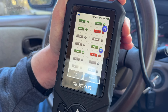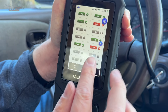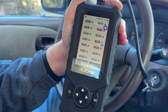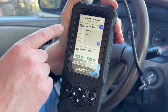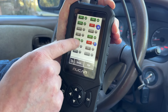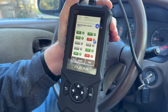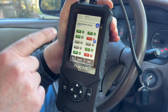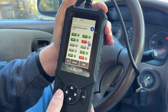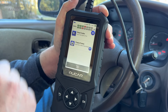So looking at the top, it gives you a complete breakdown of the car right off the top. Green is good, red you probably want to look at. I'm seeing EGR — I'm just going to try and click on this. Can't click on that, so we'll have to do some investigation. This is effectively just giving a report but doesn't let you view anything — that goes back to the expanded capabilities where you spend the extra $40 to get into SRS, ABS, PCM, and ECM. Let's get back to the home screen and jump into reading some codes.